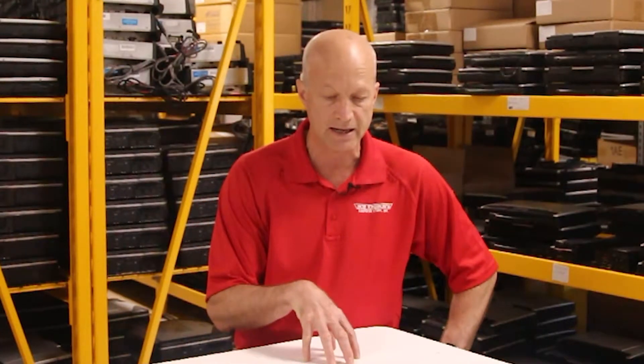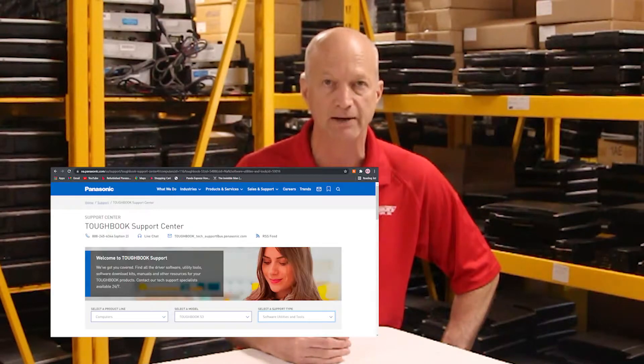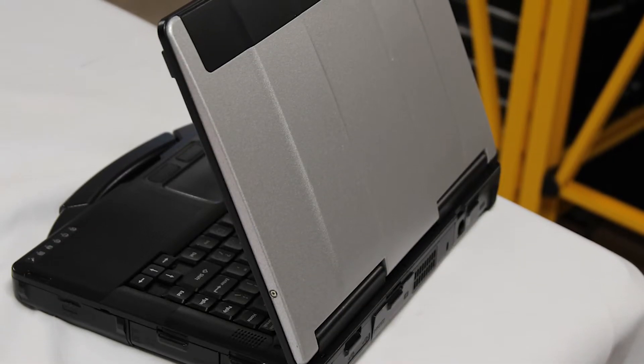Well Randy, you're very welcome. Let me touch on the Panasonic Toughbook CF-53 battery when you put a new one in. Yes, Panasonic has a utility you can download off their website — a battery recalibration tool. Now, we don't normally do it with new batteries unless there's an issue. We find an issue with the battery, we'll use the recalibration tool to check it out. But in general, you don't necessarily need to recalibrate a brand new battery unless you have a problem. I hope that helps.